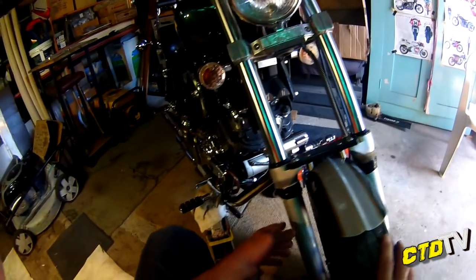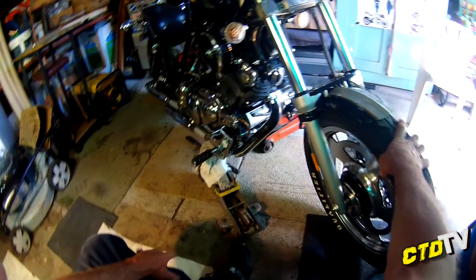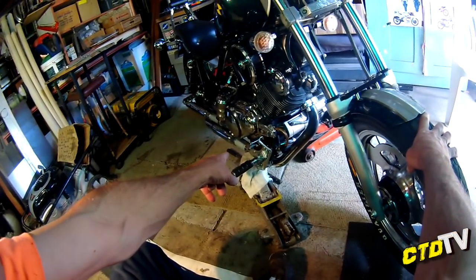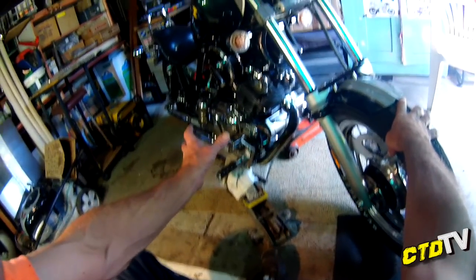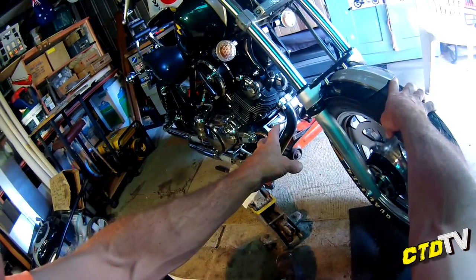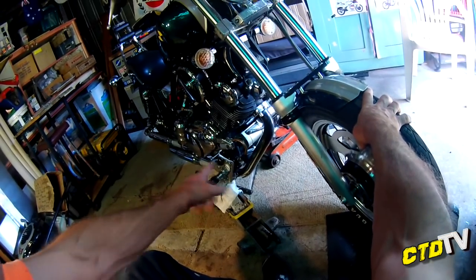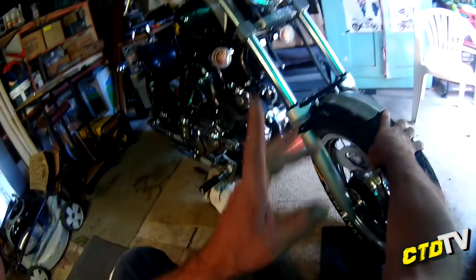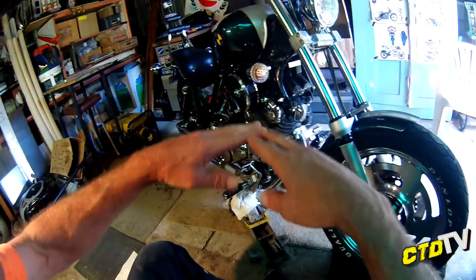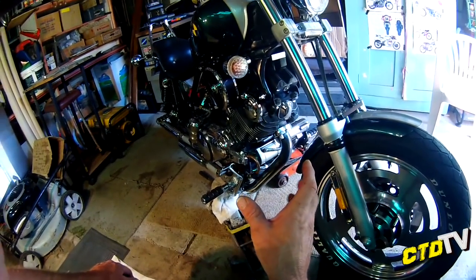But the rest of the bike, as you can see, I've got it jacked up off the ground with two jacks, or you could do one jack up one side, probably this outside, block it up with wood while it's on the side stand, get it as high as you can. Then when you jack up the other side, it should lift the front and balance out the bike before it comes too far. Should. Won't say it will. But you can do it that way. And you can always jack it up a little bit further here and put an extra block in. But you do want to make it as stable as possible.